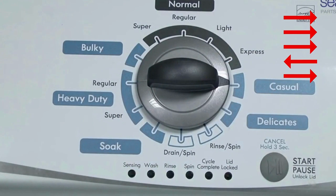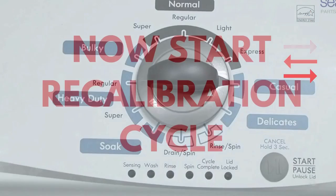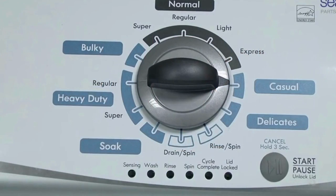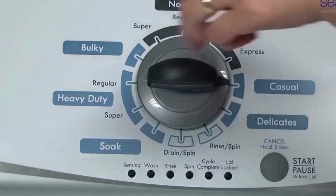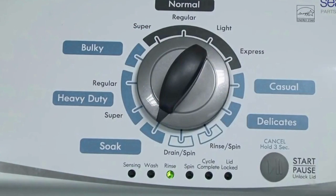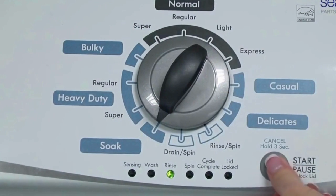All the green status lights blink when you successfully activate the diagnostic mode. If the status lights don't blink, try again — this time turning the knob faster or slower. Once in diagnostic mode with all lights flashing, select the calibration cycle by turning the control dial 4 clicks clockwise, or 4 clicks right. When you're on the correct setting, the rinse light turns on — then simply press start.